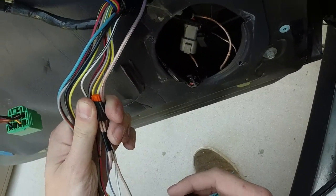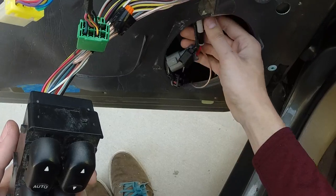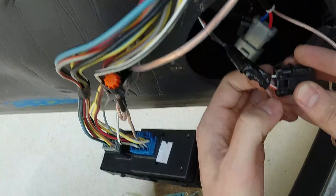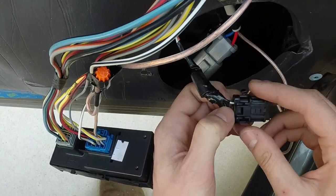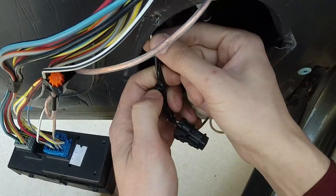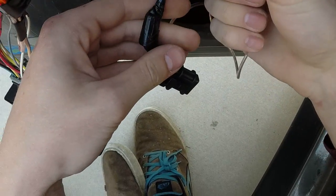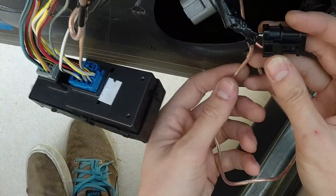I have a wire nut and then tape it up just in case of vibration so it doesn't come apart. Run the wire through the hole you've already got here for the wires. Bring it down and cut that bad wire — the one that was only getting half the voltage. Your case may be different, so that's why we tested the voltage. Snip that wire and tape it off up here. I just have it taped in place — it's not even connected anymore at all, just sitting here taped off.